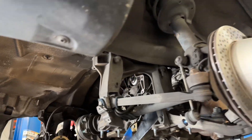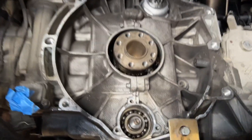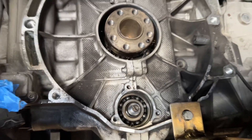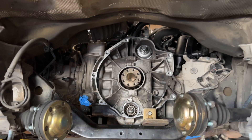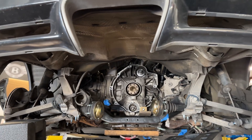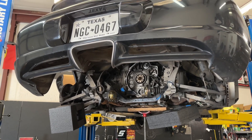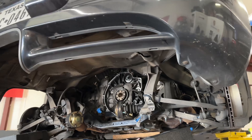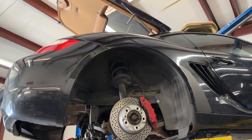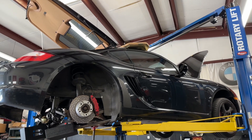Keep that in mind when you're buying one of these. Sometimes customers tell me they had their bearing replaced, and a lot of times shops install a bearing that's replaceable with the ball bearing — keep in mind there's a service life for that. The LN Engineering bearing has about a four-year 40,000-mile interval on the single row and a five-year 50,000-mile interval on the dual row. I recommend changing those at about a four-year interval. But the best solution is getting the IMS solution, which is the oil-fed bearing also provided by LN Engineering. That bearing has a lifetime service life — you install it once, pay a little more upfront, but you don't have to do it again.